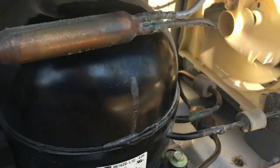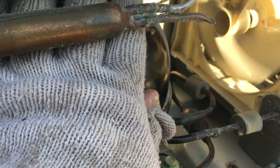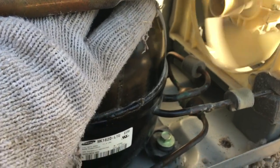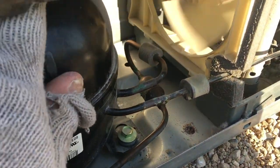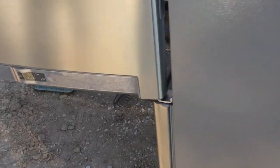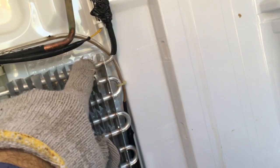I don't really feel the compressor doing anything unless it's really, really quiet. I wonder. I guess it could be a real quiet compressor. But I don't feel anything. We'll let it run for a little bit. Give it a chance to kick in. If the compressor does kick in, one of the signs will be our cooling coils should get a little cool.